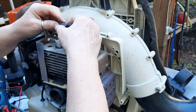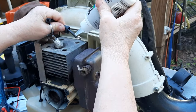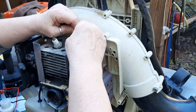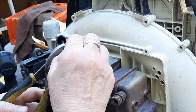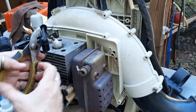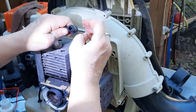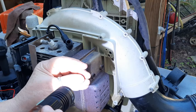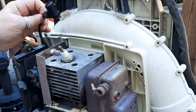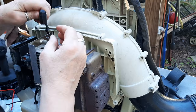I might have to trim this off because I do have this little guy right here — trim that off just a little bit so hopefully it'll fit on there a little bit better. A couple of drops of silicone oil to help lubricate that, and hopefully I can get this to go in that tiny little hole. I'm going to hold it with my pliers. The coils have spun a little bit in there. There was a little bit of flash rubber that didn't come off so I had to dig that out. I can see the spark plug boot is perfectly in there — give it 180 degrees of a turn, so it should fit just fine.